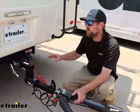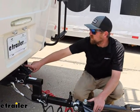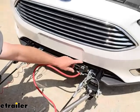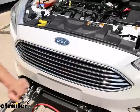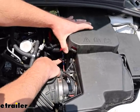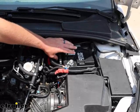In order for this kit to work, you're going to have to have a seven-way on your motorhome, which most of them do. It's going to have to have the 12-volt auxiliary power, which again most of them do, especially late model motorhomes. The auxiliary power will come from your motorhome, run through the wire, into a six-way round-style connector — that's the type of connector plug you'll need to hook this chargeline up. The chargeline runs through a wire and goes into the engine compartment, up to a circuit breaker, and then plugs into your battery post to trickle charge your vehicle's battery.